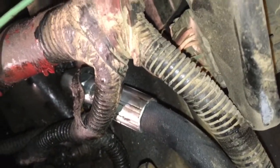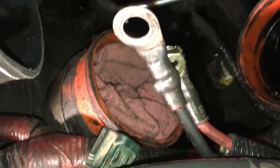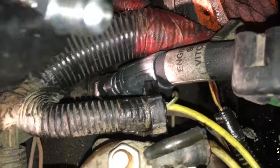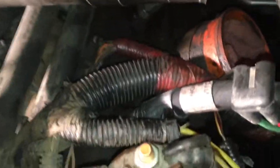I was a little worried about how bulky these lines were and how they were going to fit in here. This one comes around and loops around — I don't like it rubbing that wiring harness, you need to keep as much of that away as possible, because that's what will cause a line failure. This fitting on the head was supposed to have a 45-degree fitting on it, but that made the bend a lot more aggressive with more tension on it. It worked without the 45, so that's just an extra degree that doesn't need to be in there — extra fittings that can leak.